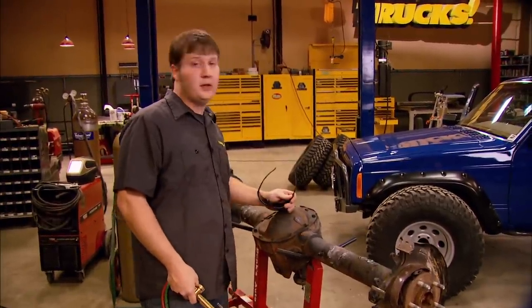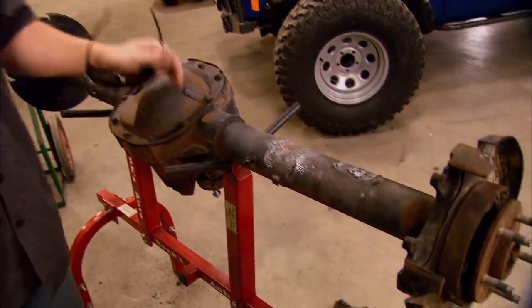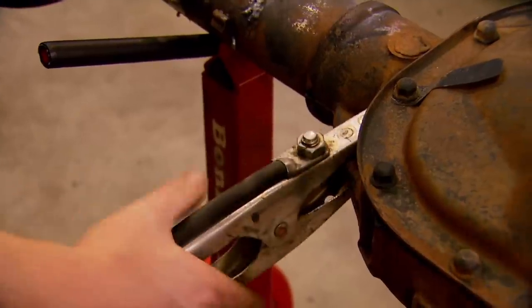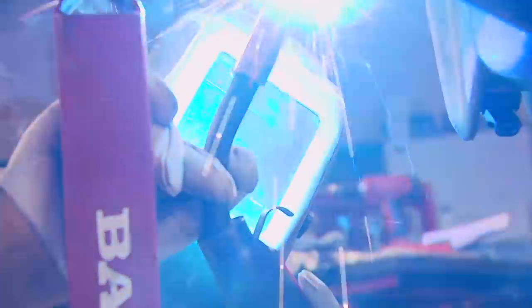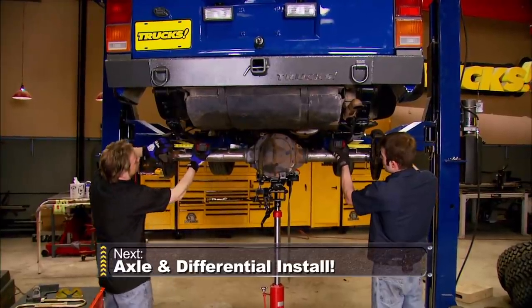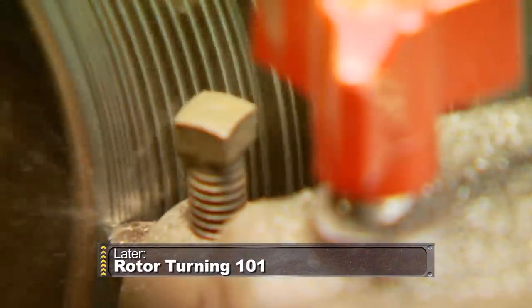This axle and our Cherokee axle both come with a leaf spring setup, but it's far from a direct bolt-in. First, before we start installing it, we're going to address one of the problems of the 8.8. We're preheating the cast center section to prep it to weld. The center section is cast from steel, which makes it weldable with a MIG. Running a bead around the axle tube eliminates the possibility of them twisting in the housing and letting us down on the trail, just like our old YJ axle did. Up next, we're making a Ford axle fit under a Jeep and putting our front diff under lock and key. And later, baby needs a brand new pair of shoes. Stick around.